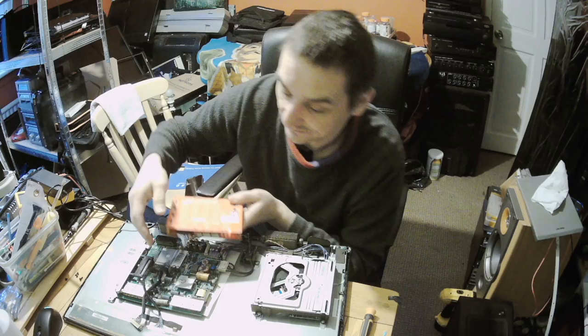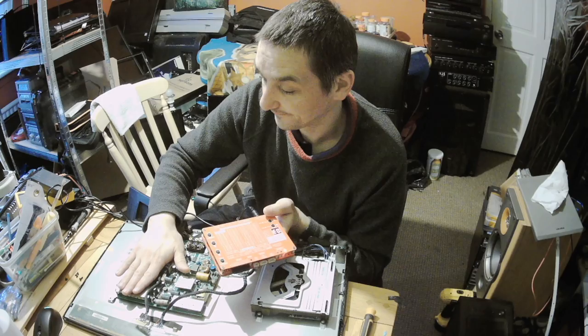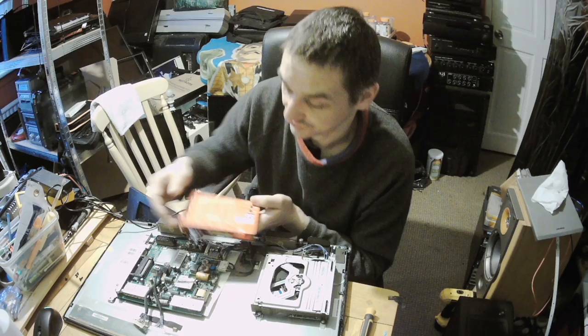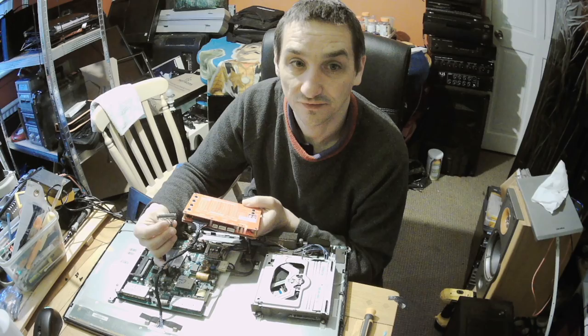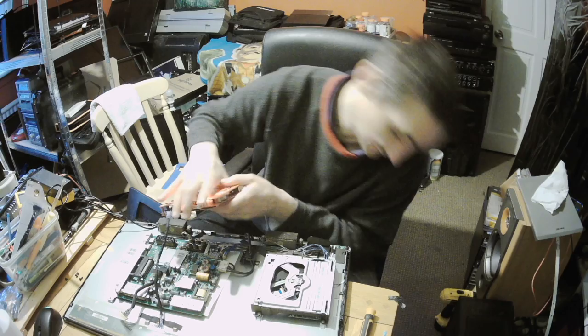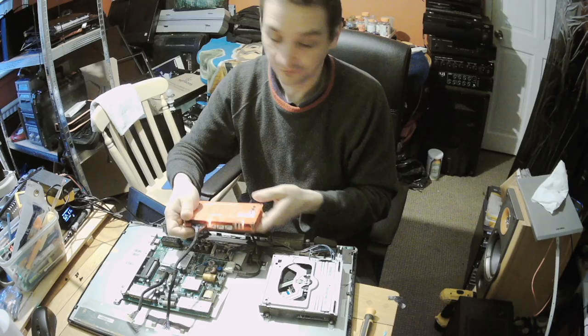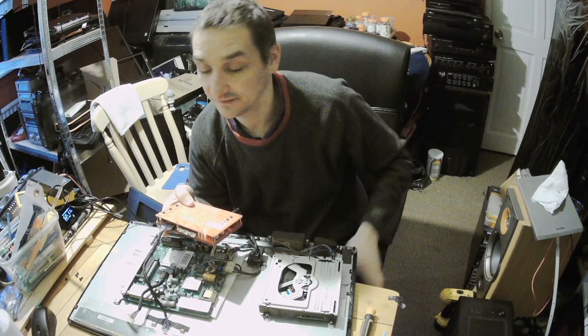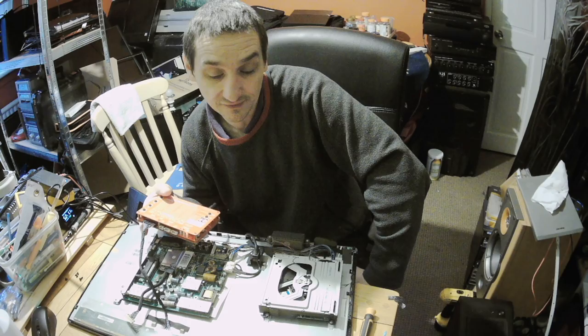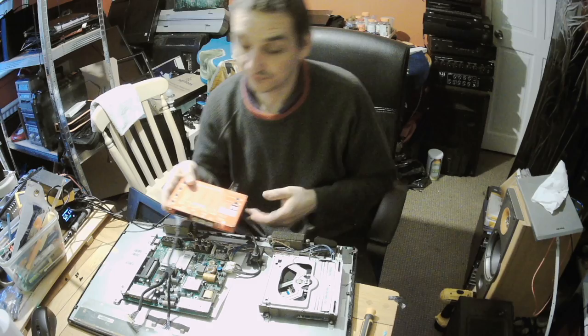You can hear the display, but you can't see even the backlight, and it's on the same side — exactly the same side. So I wouldn't say there's anything wrong with the power supply and the main board for now. I would say that's a display issue. Because if I'm testing the display, and I've got the same connector — red on the right side — and I'm switching it on, I've got power and I don't see any backlight. Then that means I can't do anything. I would have to have at least the backlight — if I don't have the backlight, there is an issue with the backlight. So the LEDs in the backlight are probably dead from what I see. Further investigation would lead into a lot of time, so I need to speak to the customer.